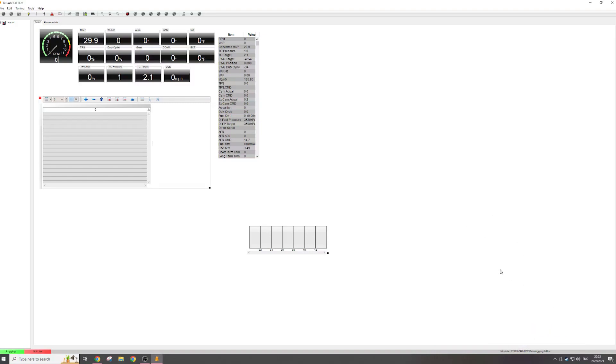If you have the V1.2, you'll still come over to the K-Tuner screen. Plug in your K-Tuner 1.2 into your laptop and into the OBD module. To log while you're in the car, go ahead and hit the record icon — it's going to say recording at the bottom and capture what it needs to. Once you're done, hit the record icon again, then you can play it to double-check that it captured correctly. Then do the same saving process — hit save, save it to whatever folder you need, and send that off to your tuner. Hopefully you found this portion helpful.